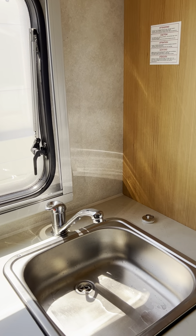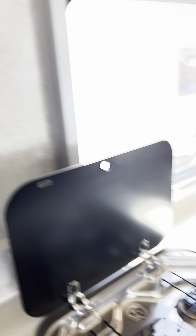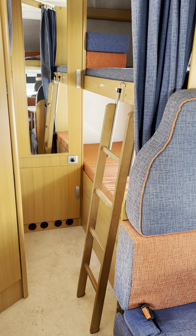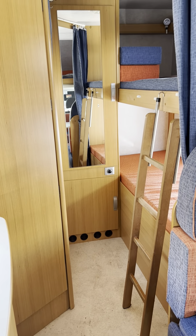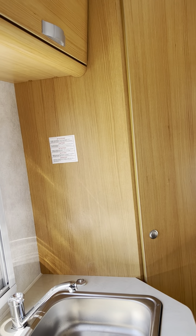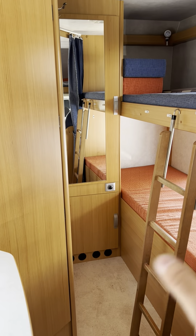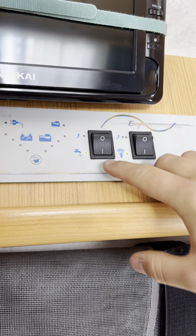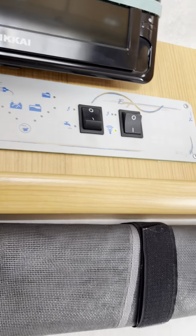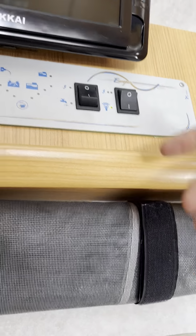Once you're sure of that, you can go ahead and use the boiler exactly as you want to. The reason you have to do that is that if you haven't got any water in the boiler and you try to light it up, it's going to overheat because there's no water in it to actually heat up. You need to make sure it's actually full — just doing that gives you enough of a chance to know it's definitely working and full of water before you start lighting it up. As for the pump, I would always switch it off when not in use, purely because if for whatever reason the pump was running quietly it would end up burning itself out if left on.